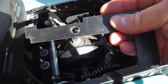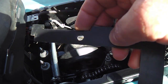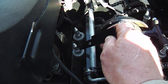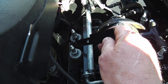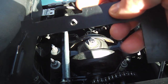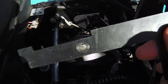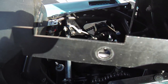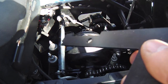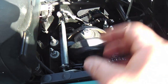And the one that really was kind of surprising, wasn't in the literature, is this setting here for the rear section. These are called the torque springs. They're really rubber bushings, but they start you out with this amount of space or load of those bushings. And sure enough, you can set them both the same, but you'll end up sometimes, especially I think with mine, because those bushings were 20 years old